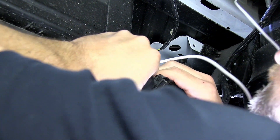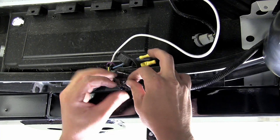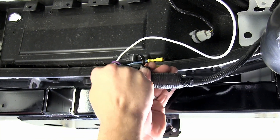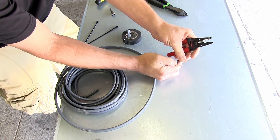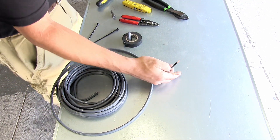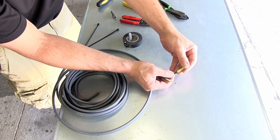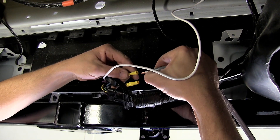To secure this connection point for longevity, I'm going to go ahead and take a zip tie and secure the two connectors together from our new 4-7-pole to the manufacturer's 4-pole. Now we can go ahead and take the wiring from our draw-tight installation kit. We're going to strip back the sheathing and the wiring cover so that we can make the connection with the blue and black wire coming from our 7-pole. We'll go black to black, blue to white.